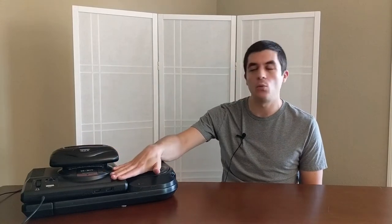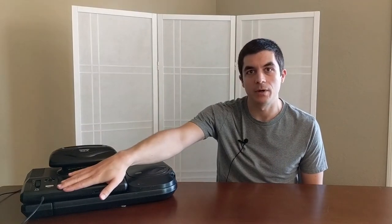One of the many joys of owning a system this complex is that troubleshooting an issue like this can be a little difficult. You have a lot of different interconnects between the different pieces of hardware: the extension port going to the Sega CD, video out from your Genesis going to your 32X, and in the case of a Model 1 Genesis, this additional mixing cable with an interconnect. You also have audio coming from the headphone port out of the Model 1 Genesis into the back of the Mega CD, which was an issue at one point when my connections were dirty.